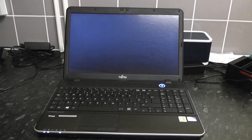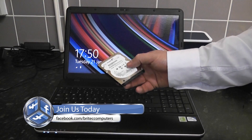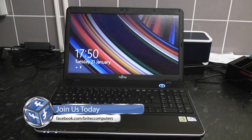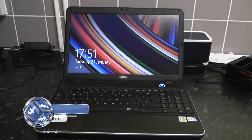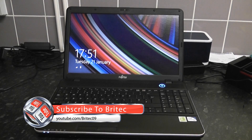Be patient and let it do its thing — it will eventually boot up. The most important part: no matter what software you're using, make sure it's the latest software that supports GPT and Windows 8, otherwise you're going to have a hell of a job cloning. As you can see it's booting up just fine. If you've upgraded your drive or your drive has failed, this is how you can salvage all your stuff. I hope this answers all your questions. My name is Brian from BritecComputers.co.uk — if you enjoy these videos, hit the like and subscribe buttons. Thanks for watching!